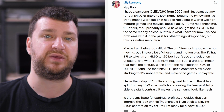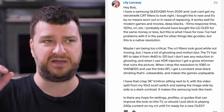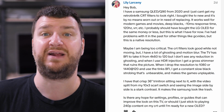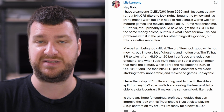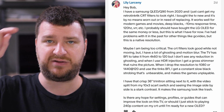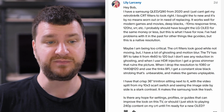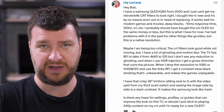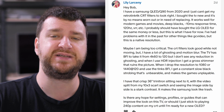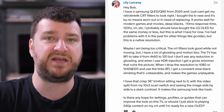I'm just making the comparison to say that LCD technology is definitely different, and the way the backlights work, the way the pixel grids are lined up could make a big difference. And also, I've seen some that are, instead of red, green, blue, blue, green, red, and that sometimes makes text a little bit blurrier, and that will absolutely affect video games and scan lines. I've seen some panels that were upside down. I still to this day do not understand why, but instead of writing from top to bottom, they're very clearly flipped inside the chassis and they write from bottom to top. That's caused some weird issues because then you do have the individual pixels reversed, mostly for PC and filtering stuff, not so much for just watching TV. So it could have been any of those little things.